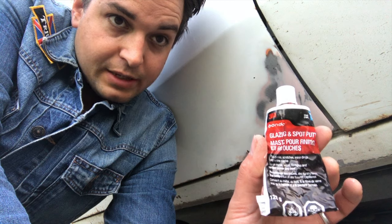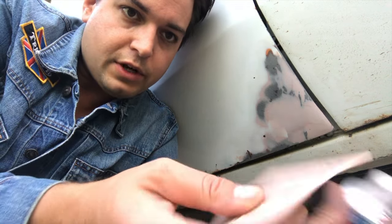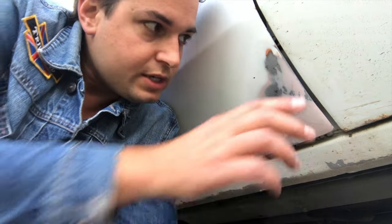The next thing I'm using is the glazing putty. Unlike Bondo where you have to mix in two parts to get it to harden, this just comes straight out of the tube ready to go. So we're going to apply it straight to our applicator and give it a thin coat. Even though this is just a backyard job, you still want to make sure you take good time in your prep and you don't want to just paint over rough bodywork because it'll look awful. Then I'm going to move from the 120 to a 220 grit sandpaper and sand this whole area after I've done the glazing putty.